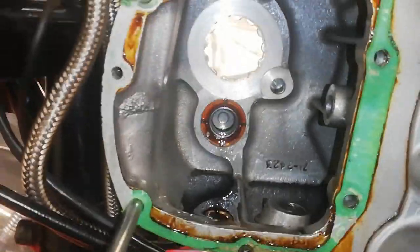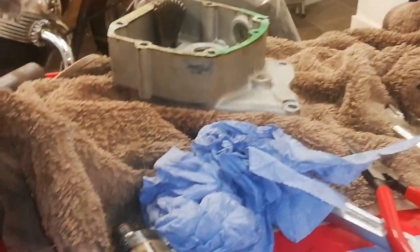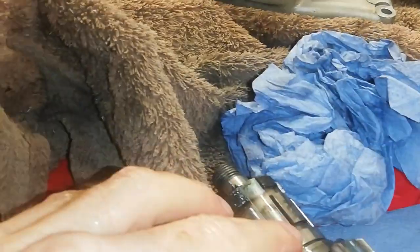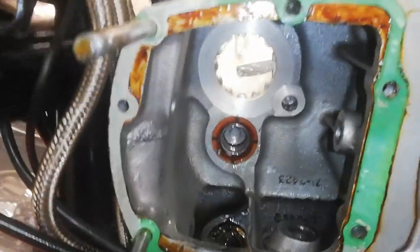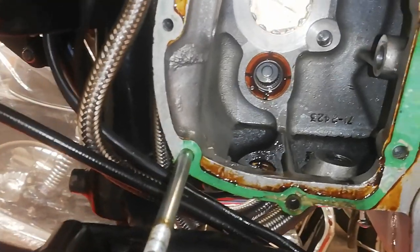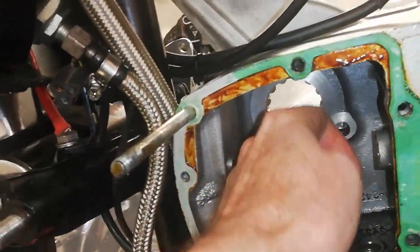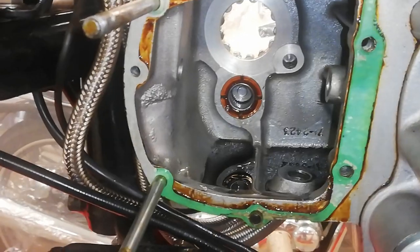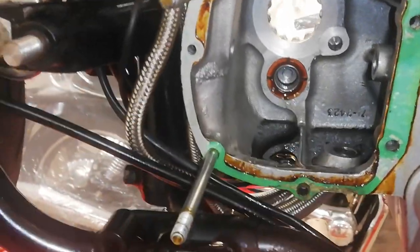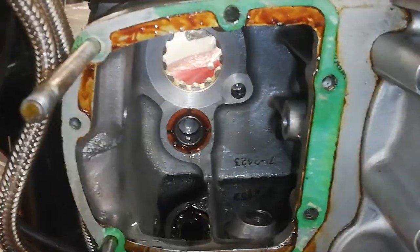These are the gearbox innards. This is the gearbox main roller bearing which runs on the high gear or sleeve gear — you want to make sure that's in perfect condition. In my case I've only done a couple of thousand miles since I rebuilt this gearbox and replaced all the bearings, so I won't be replacing them again. But if rebuilding for the first time in a long while, you'd almost definitely want to replace all the bearings as a matter of course, because it's such a big job you don't want a bearing to fail after reassembly.